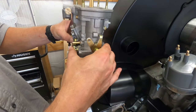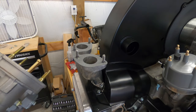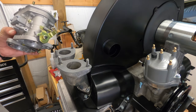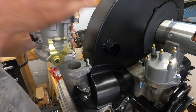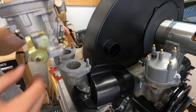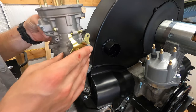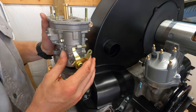These are CB Performance carburetors — I bought them from CB Performance. They're space-saver carburetors, so the manifold is designed so that all the adjustments are on the inside. You want to make sure your fuel inlet is facing back. It's not going to be a huge deal, it's just going to look goofy with it pointed forward.